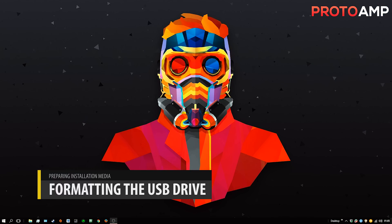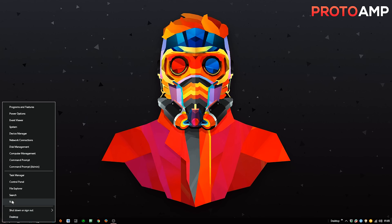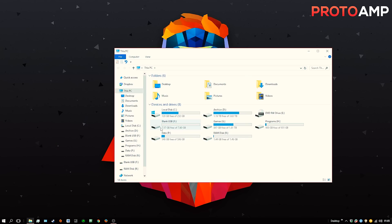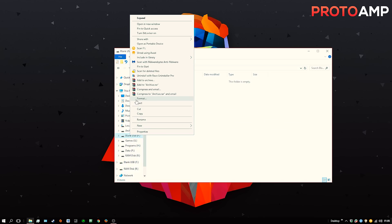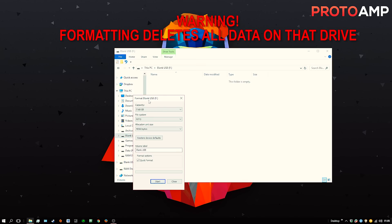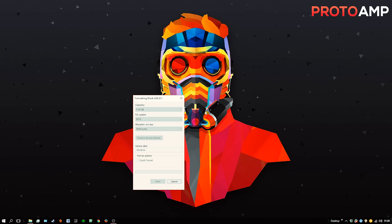This is really easy. In Windows, go to the bottom left of the screen where the Windows icon is and right-click it. This should bring up a bunch of options — go to File Explorer. Find the drive via My Computer or through the drop-down on the side, and right-click on the memory stick. Move the mouse up to Format and click on that. Note that formatting the drive deletes all the data on it, absolutely everything, so if you have anything precious on that memory stick, copy it somewhere else beforehand. For capacity, select the max it will go. For File System, choose NTFS. Allocation units are best left as you find them, and select Quick Format. It doesn't really matter what you name it since Windows changes that anyway. Click Start, and another pop-up will appear warning you about erasing all your data — click OK. Let it do its thing, and once it's done, click OK and close.